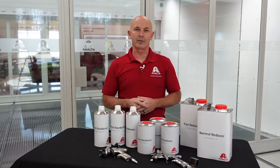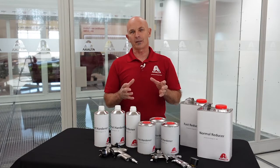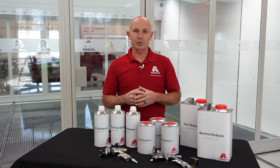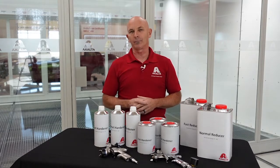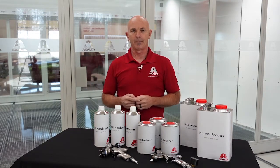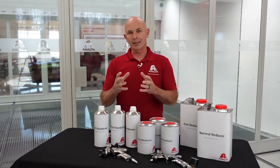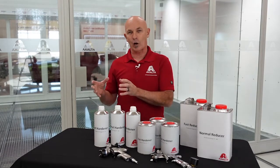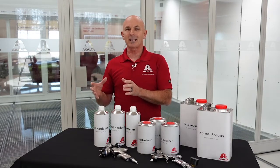There are a lot of things to think about. We may be spraying a seven or eight panel job — a large job — on a normal temperature day, but we may want to select a slower reducer. You might ask, why would we want a slower reducer if the temperature lines up? Well, when we spray a large job, the ideal thing is that when we get back around to where we started, the surface stays just a little bit wet so our overspray will melt into that.